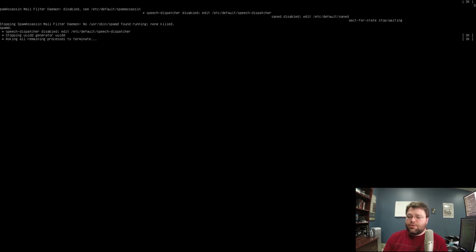But by and large, just using the BIOS to say, I want to boot from this operating system, or I want to boot from that operating system, works better. Almost all UEFI supports keeping track of multiple sets of secure boot keys, so I don't think you'll run into a problem there. Now, you may have to go back into your UEFI and pick the device you want to boot from.